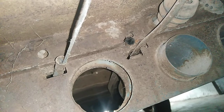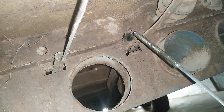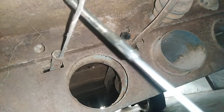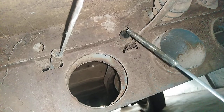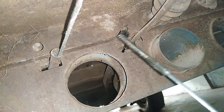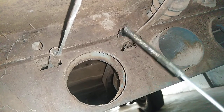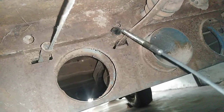Now we are under the car. You see this tube right here — you fill it up with grease first. This is very important so that the cable does not create friction when it comes in contact with this tube or with the metal. It needs a kind of smooth back and forth, because you'll be pressing the clutch cable and it will be going back and forth.